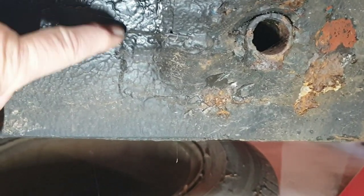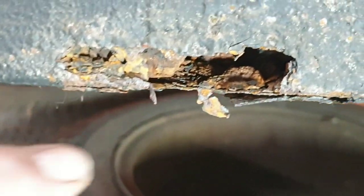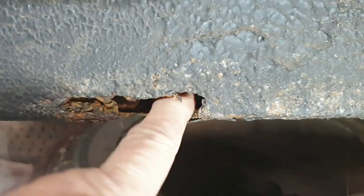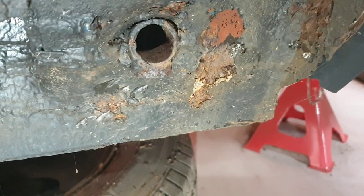And you can see they've welded down there and along there, but they've only put a plate over existing rusty metal. They've done a weld all the way across, put a plate in all the way across the top there, as you can see, and then coming down on the bottom edge you get to this point here. This is what I thought was new repair metal, and they've just gone over existing rust. So needless to say, look what's happening. You just push that, it's just absolutely crumbling away. So we're going to have to attend to that. I'd hate to think what's behind that mess there.